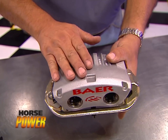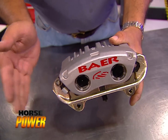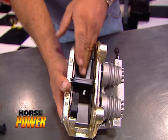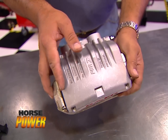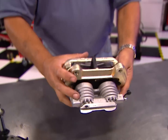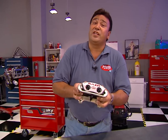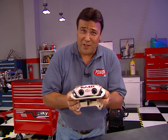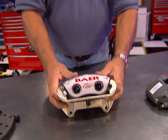Next, we have an aluminum caliper that uses a steel anchor bracket to surround it and the pads, so they're always parallel to the rotor. This design reduces caliper flex significantly, and the braking loads are transferred directly to the anchor bracket — adding up to better balanced clamping forces, improved driver control, and shorter stopping distances. This is a good upgrade for your street car.